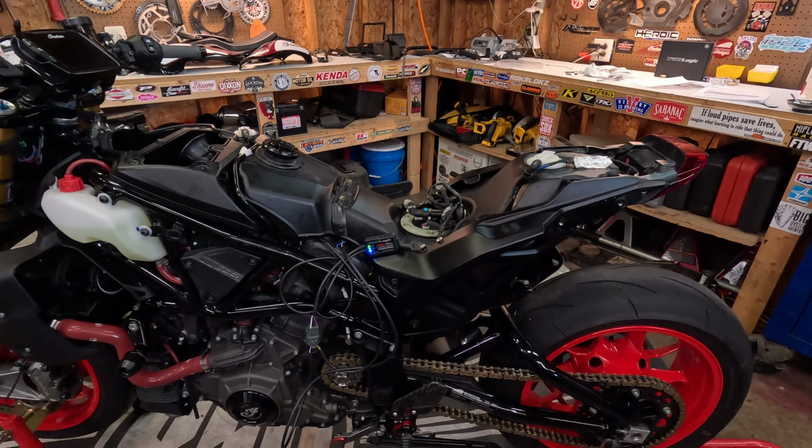One thing I did, cutoffs were fine. Shift force was a bit too much, but luckily it's right there, so I can adjust it. Go over here to the instructions. It's basically just like setting your suspension. Turn a dial one click at a time. So I'm gonna go ahead and turn it back counterclockwise one click to see how that works.